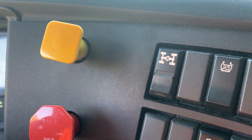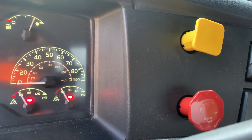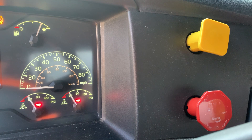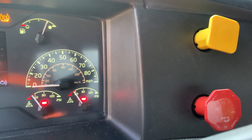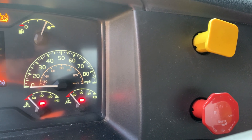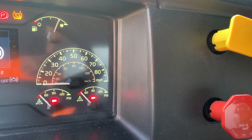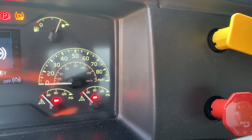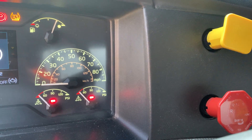These valves should pop out between 20 to 45 PSIs. We're going to fan down — it should not pop out below 20 PSI; it must be between 20 and 45. We're going to rapidly fan down. Both valves have popped out at 22 PSIs, showing that the system is working properly. And that's your air brake leak test.